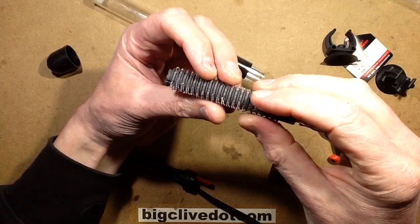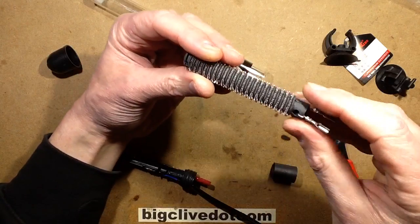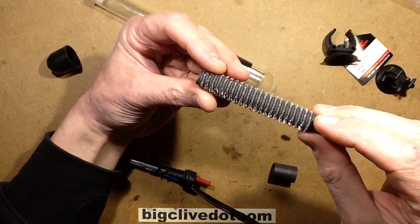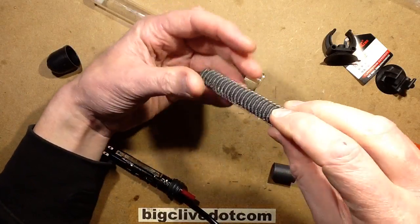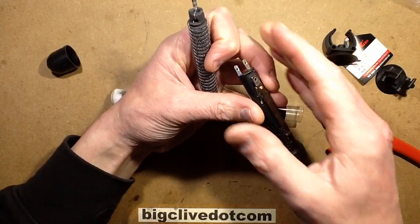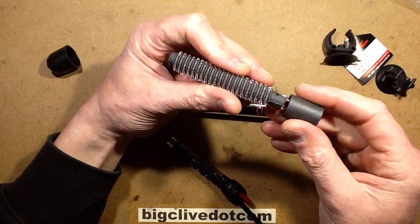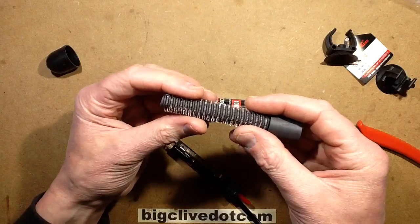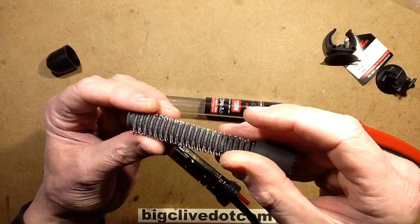The heating element wire itself seems quite robust — more robust than I was expecting for something rated just 100 watts. I thought it was going to be lighter than that. It makes me think you could actually use this little block as a heating element for something else. In fact, what comes to mind is the desiccant dehumidifiers, because they require a sort of low wattage heater inside them — I wonder if that would work. Not really an awful lot to it — it's mains going through a thermostat inside the whole body, then just switching this little heating element. If you imagine having to buy a heater for a specific application with a ceramic core, in most industrial-ish applications this alone would cost quite a lot. I wonder how reliable it would be in long-term use.